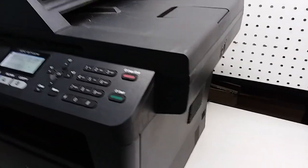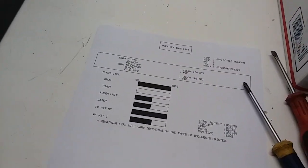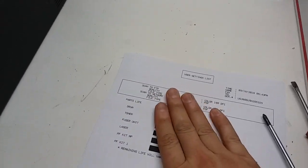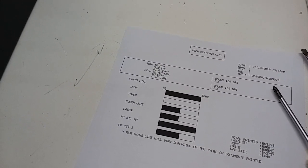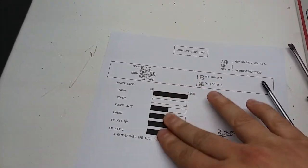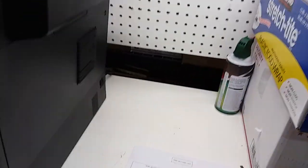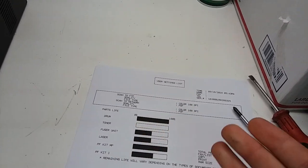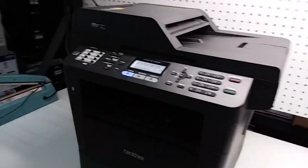If anything comes out of the printer even slightly blurry, or one part of it is blurry, just wipe your hand over the printed area. In this case we have a good fuser — nothing was smeared. The fuser on this printer is good even though we have 53,000 pages already printed. But if you swipe your hand over a printed page that had blurriness and look at your hand and it has black dust on it, the fuser is bad.